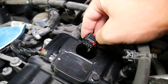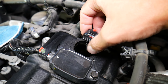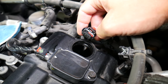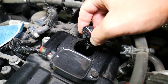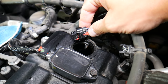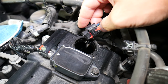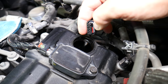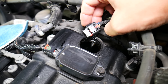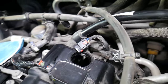That connector is often not pushed all the way in, or people don't use the safety lock to secure it so it can't disconnect while driving. Also, if you have an oil leak from the valve cover, it can contaminate the wiring harness and affect signal transfer. Check for oil leaks, dirt, contamination, and water — sometimes washing your engine can corrode the wires. Another common issue: when disconnecting the sensor, people pull on the wires at the back of the connector and yank the pins out. As a result, the pin may not be making contact, causing a bad camshaft sensor code even though it's actually just a wire pulled out of the connector.